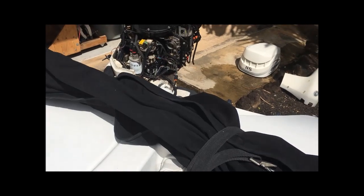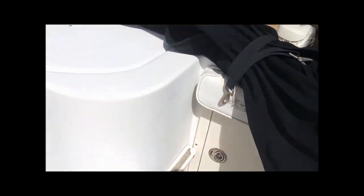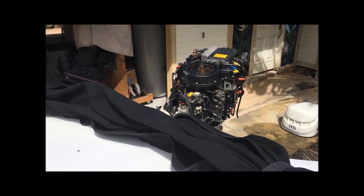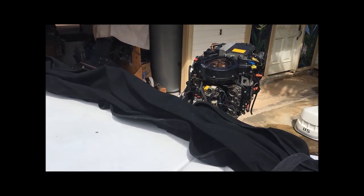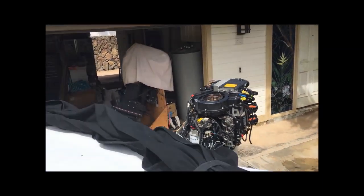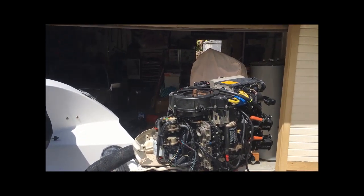The water's running and this is on the weaker of the two batteries that used to just spin. I think it's the wiring because it's longer — it's the battery on the port side, which goes to the battery switch on the starboard side, then goes back to the starter. It used to just go and spin and not engage the flywheel. But that's what it's supposed to do — if the engine starts, it disconnects the Bendix and the Bendix just spins, so you don't have the engine driving the starter.